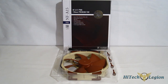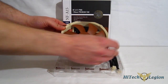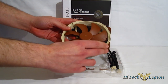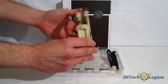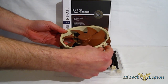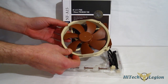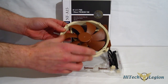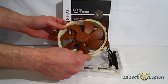We're going to begin with the NFA 15 PWM. The basket is obviously significantly different than the square basket we saw on the others. It is actually a 140mm fan with a round basket and 120mm mounting holes. This is going to be perfect for use on CPU coolers. It does have PWM, which the others do not. With the 120mm mounting holes, it's going to be easy to use fan clips on a CPU cooler that typically uses 120mm fans, allowing you to add a lot of airflow to such a cooler.